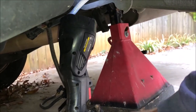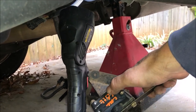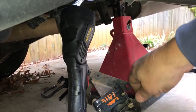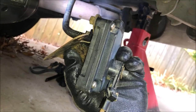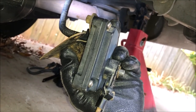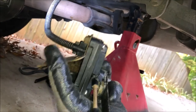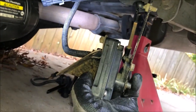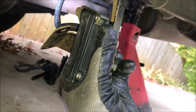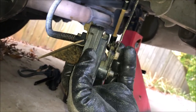The suspension is operating. I can turn it off — there it goes. I heard the opening of the valve, the exhaust, and the suspension is dropping. So let's articulate it back in the other direction once again. It's pumping up again because I articulated it up. So the first junkyard sensor is confirmed working.